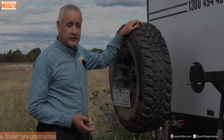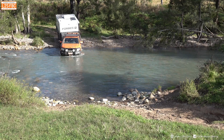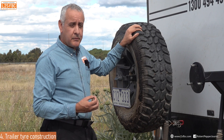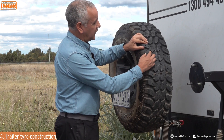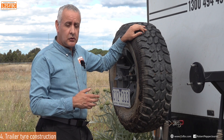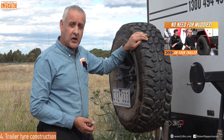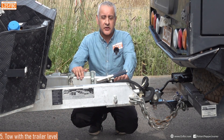The tires on this caravan are only three years old, so I've got a fair way to go. This caravan came standard with mud tires, which I haven't changed yet, but mud tires really aren't required even for off-road towing. I'd be quite happy with all-terrains — I need a strong light truck construction tire, not this very open mud terrain pattern. The large deep tread blocks cause the vehicle to squirm, and you won't get the road holding and grip that an all-terrain offers, particularly in the wet. When these tires wear out, I'll be changing them to all-terrains. Mud tires do not help in a sway situation.